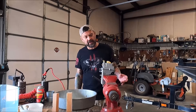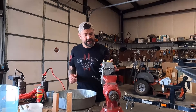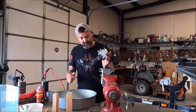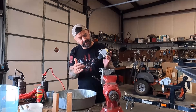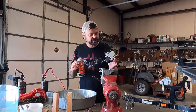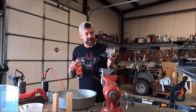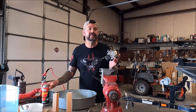Once you get your VST off and you get the top half separated, you can see I've already pulled the pump out, but there is a float in there. Get yourself some carburetor cleaner and get to cleaning that. Make sure your drain valve's clean, the tank's clean — get up inside there, spray everything down. There's a needle and seat in there; make sure everything is clean and functional.